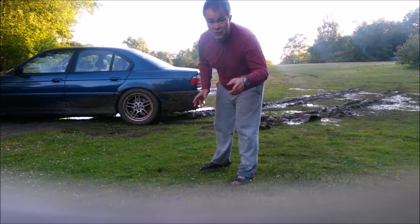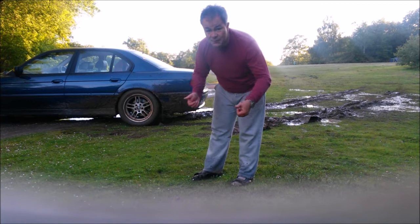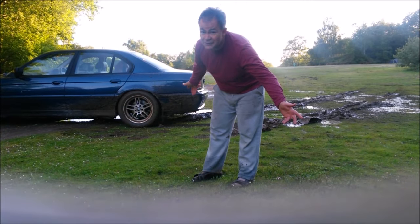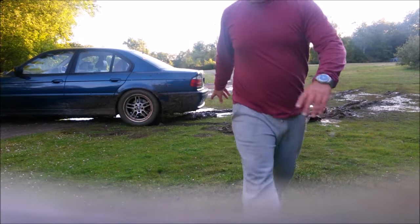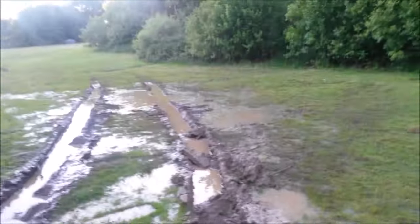But there is more you can do. If you have footrest carpets, you can put them under the tires, you can let the tire pressures down. And even have a tow rope with you in case a passerby can drag you out. And that's just one person moving a 2-ton car on 2-wheel drive with summer tyres.